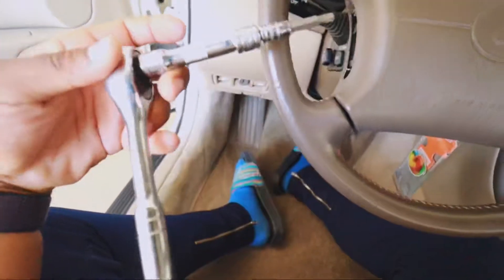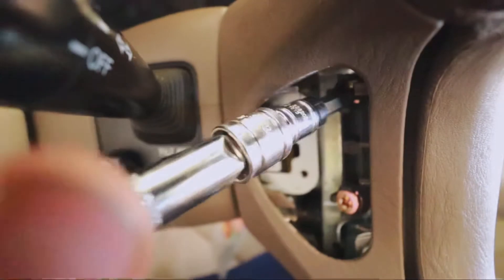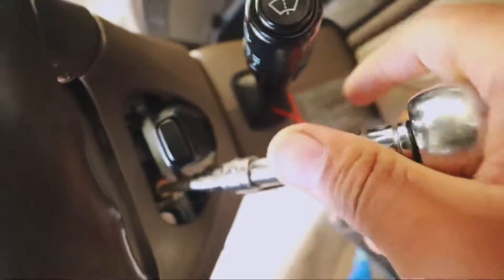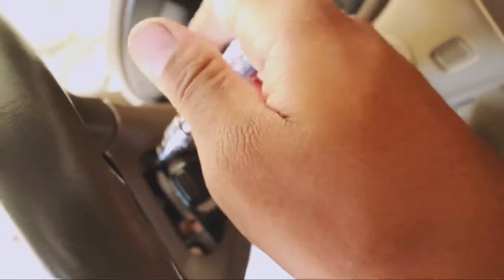So we're gonna get that special bit for that and take it off really quick. I got the tool right here on a loosen - got an extender so I can get to it easier. We're gonna take this side off also. These bolts don't come all the way out - they stay in here; they got little plastic housings that don't let the bolt come all the way out. That's all the way loose - let's hit the top one now. You should see this airbag starting to come loose. That's what we want.